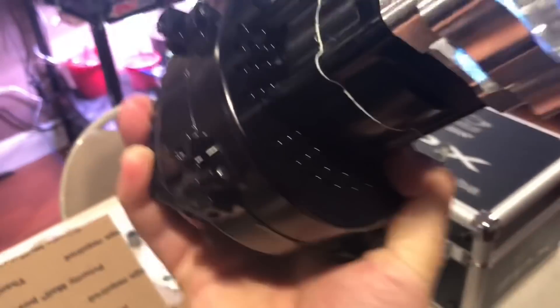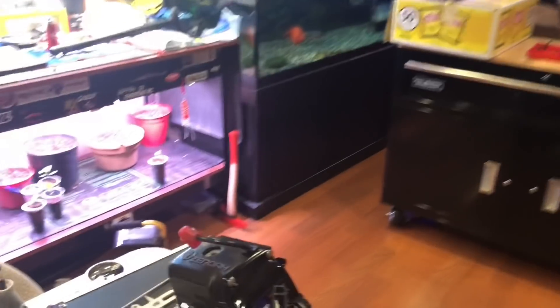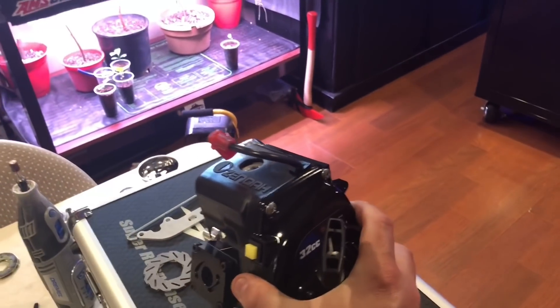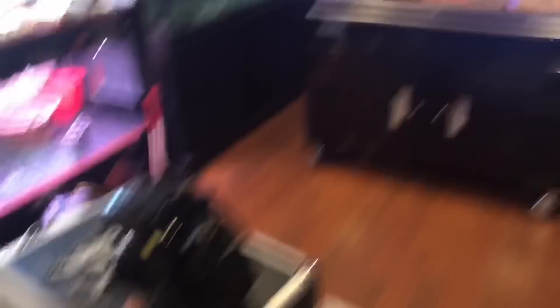Now if you ever want one day in the future, you can always take it out and throw it in one of your bashers. But take your time - hurry up though, because soon we're going to be drag racing, so start getting it ready, break it in. You're going to want a velocity stack, so get a velocity stack. Throw the carburetor on, torque it down to 65 inch-pounds so the carburetor is on right. Take this out, put your kill switch on, and throw in your spark plug. After the break-in, after you do a gallon or three-quarters of a gallon, take the spark plug out and put a fresh one before you race.